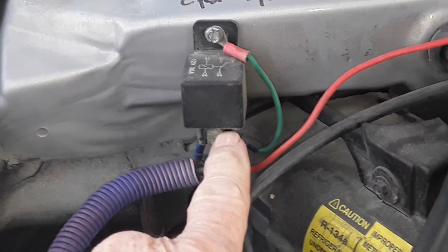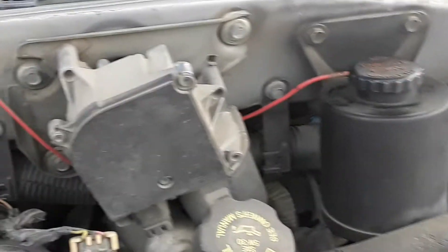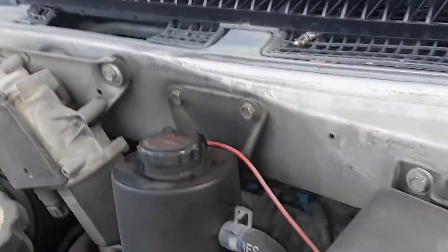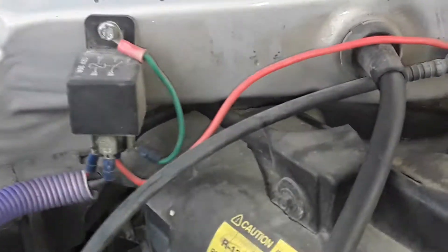This is the relay I put in. I've got a power supply — the red wire — which just kind of nonchalantly crosses over the back. I've got to slip that in a piece of conduit later on. Then it comes in underneath here, attaches to this fuse — an externally mounted fuse. Then it goes over here to the battery supply. Through the fuse we get a 30-amp line, over through the firewall, around the firewall, and over this way to the relay.